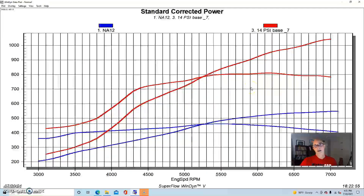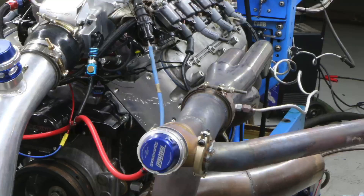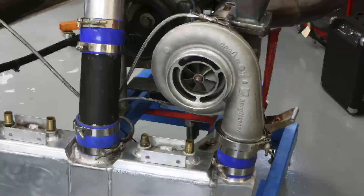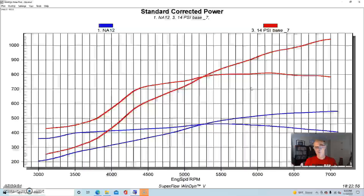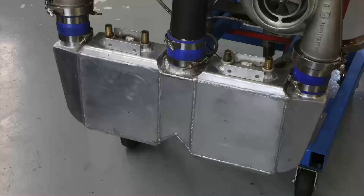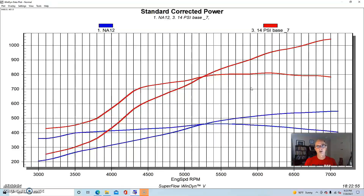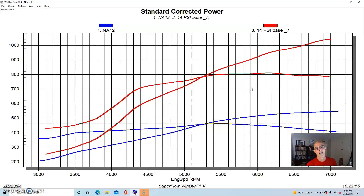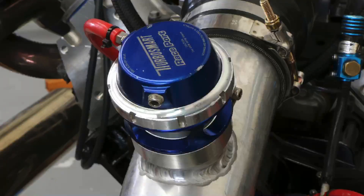This was at 14 pounds. Our twin turbo setup for the Big Bang motor consisted of tubular headers from DNA, both feeding a pair of BorgWarner S475 turbos. The turbos fed boost through a twin-core air-to-water intercooler from CX Racing. All the boost was controlled through a pair of 45mm TurboSmart wastegates, and they also supplied a blow-off valve — two in and a single out.